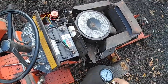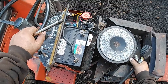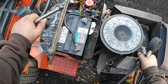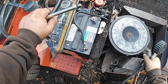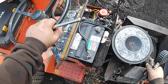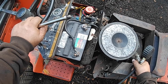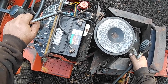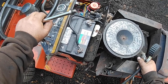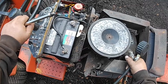So that's how you do a compression test on a small engine. On engines like Briggs, Kohler, Tecumseh, and probably some Onans, there's a compression release and it's not going to give you a true reading. The compression release helps it start easier — it releases compression until the engine hits a certain RPM when it's firing. But if you're reading zero, then you know you've got a bad cylinder. Or if you've got a big difference between the two, then you know you've got an issue. If you do enough compression release engines, you'll get to know what a baseline is and get an idea of the condition of the engine.